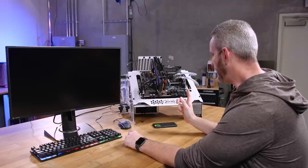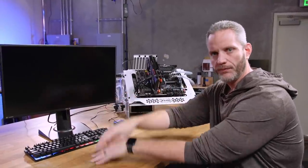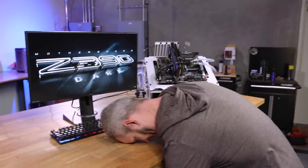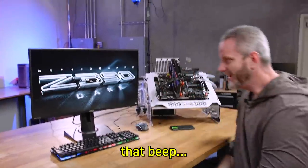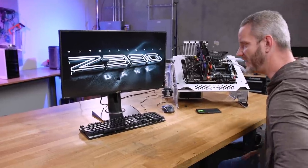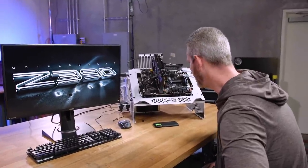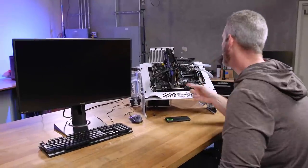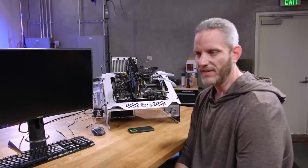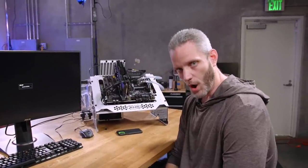Because I know it's having a problem when it hands off to the hard drive and the OS just kind of gives up — same thing. I can't even get it to go to safe mode, so I'm going to flip to a different BIOS on the motherboard. I'm just curious now if this is a BIOS-level problem or a hardware problem.